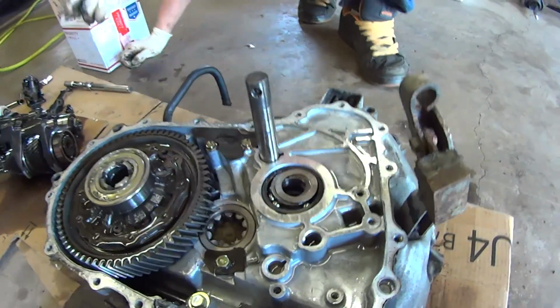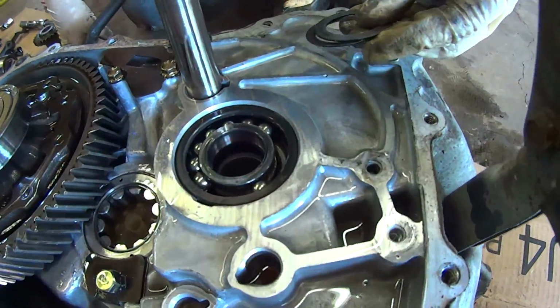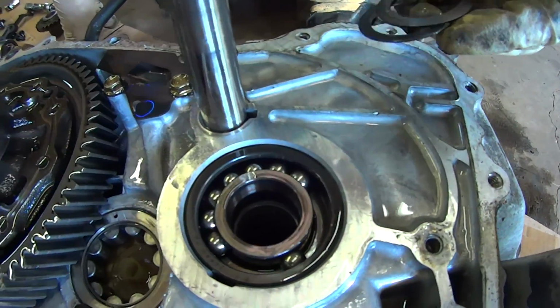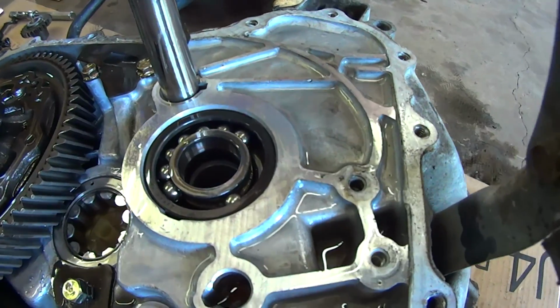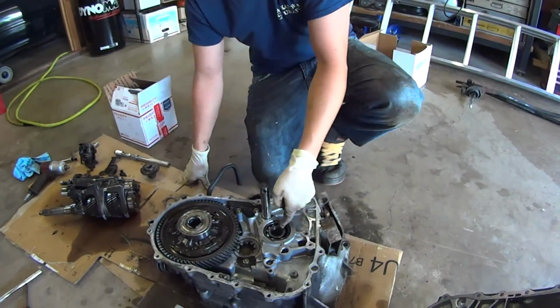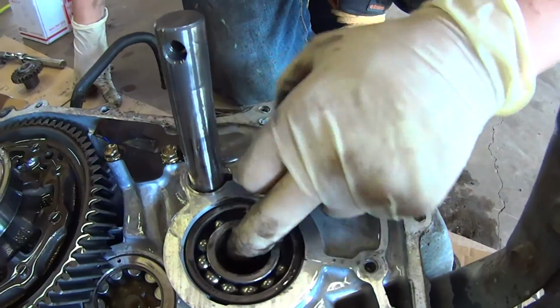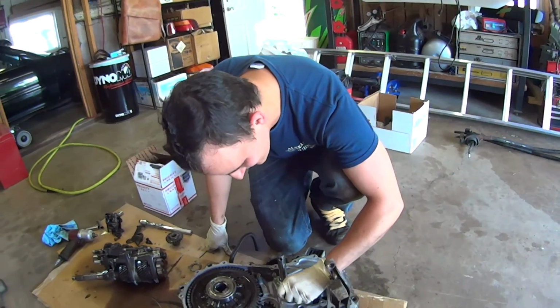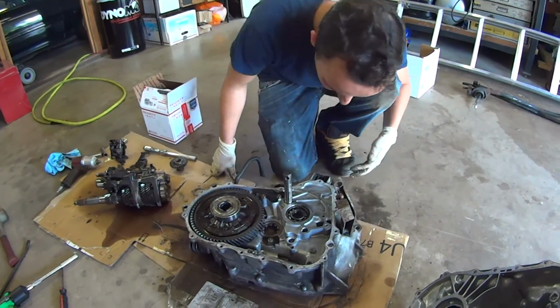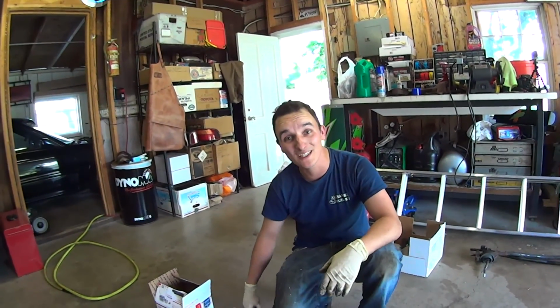Now, reverse gear. You go there. Wow! Where's the rest? Oh, man. No wonder you're burning clutches. Dude, half the ball bearings are missing. I wouldn't go quite half. Look at that. Wow. Well, yeah, now we know why it keeps breaking clutches.